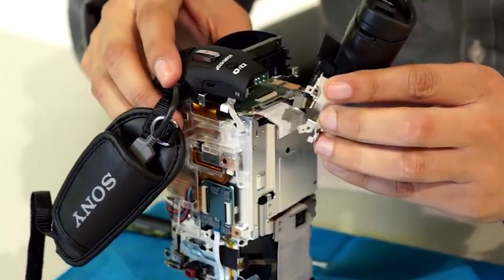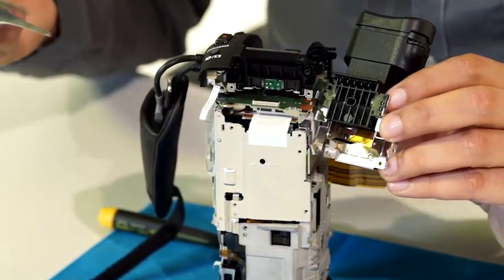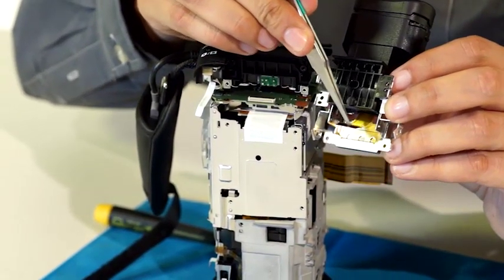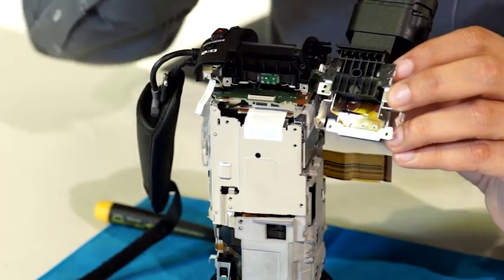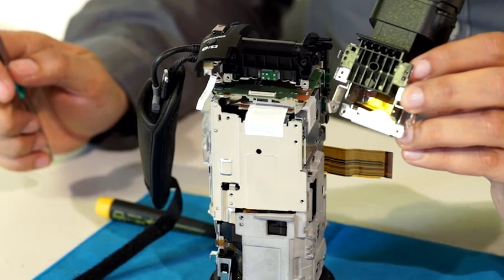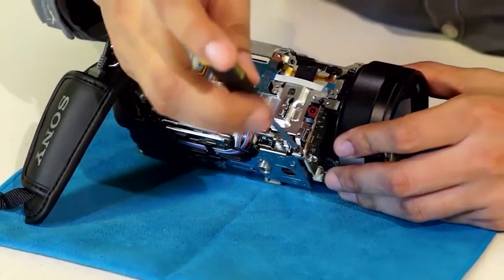When the other side of the case is removed and the viewfinder is pulled out, we see the microphone. Once that is removed, we need to release the multi-interface connector which connects various parts of the camera together. The metal part revealed is made of magnesium, which allows the heat of the camera to dissipate.